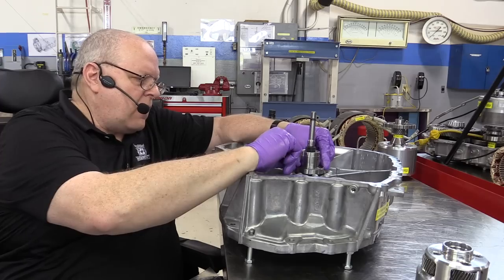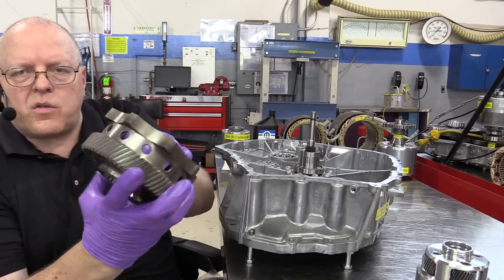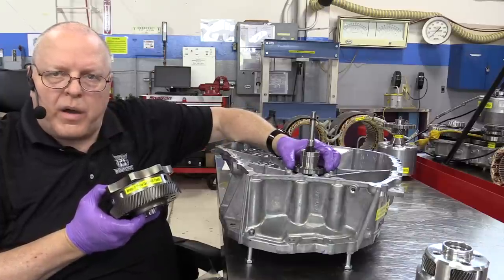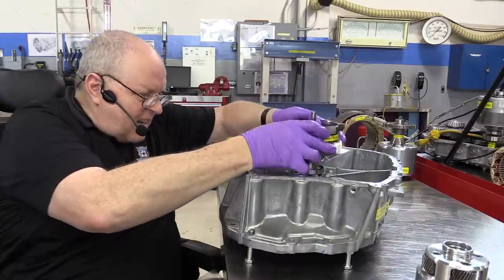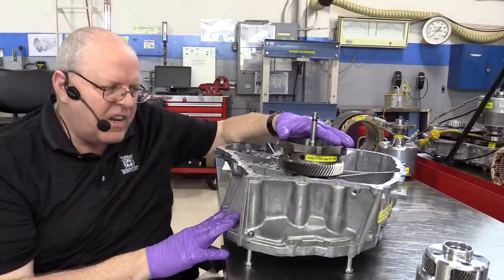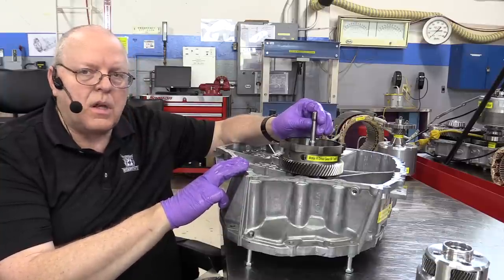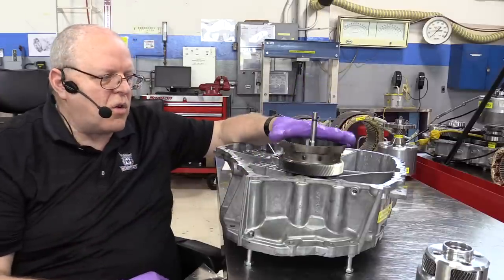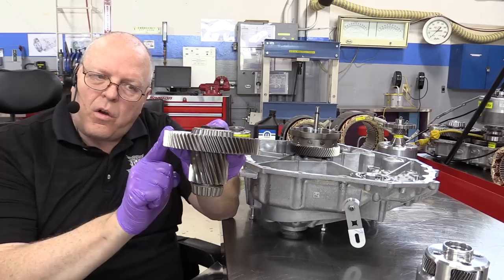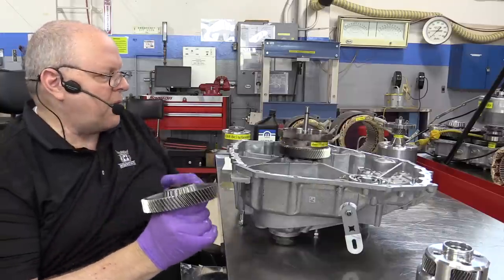There's a selective shim that goes on top of the bearing for the counter drive gear. This counter drive gear will sit right on the bearing that's part of our bearing and sprag support assembly. So I'll sit that down on there — this is our counter drive gear. When motor A, the electric starter-generator assembly, rotates, it's going to end up turning this counter drive gear. The counter drive gear meshes with a counter driven gear: the counter drive gear has 69 teeth and the counter driven gear has 70 teeth, so it's just a very slight underdrive gear ratio.